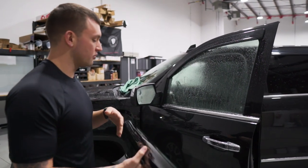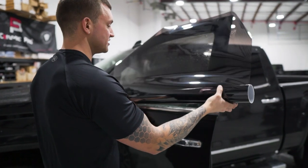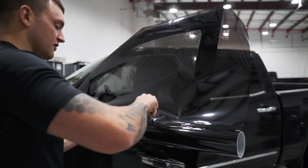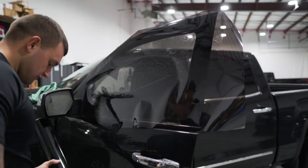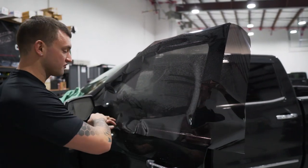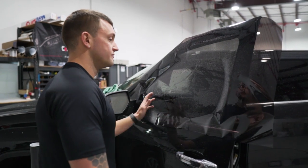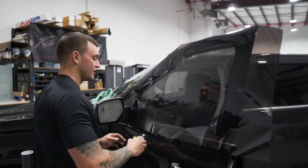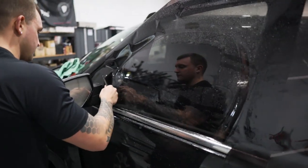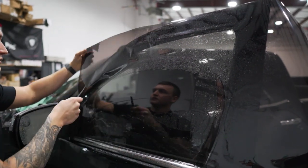We're using 20% Suntec Standard Pro. I'm going to go long ways so I can limit having to have the material lay over the top edge. But if you have a 20-inch roll, that'll be the optimal way to go — since you can use a 20-inch roll for the height of these windows. Since I'm using a 40-inch roll sideways, we're going to have to cut the bottom edge first, then cut the front edge, and shift it forward. We'll mount it in place when we cut the bottom and the front, then cut the bottom edge and cut that front edge, and cut off the excess material.